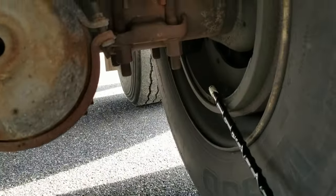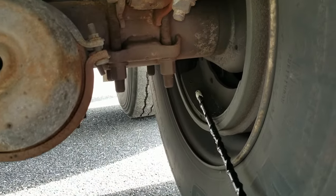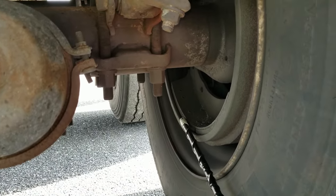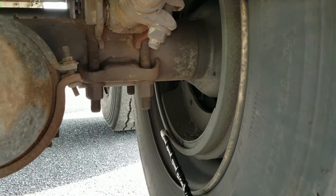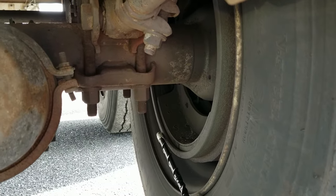I'll move into my brake shoes and brake drums. Make sure there's no signs of oil or grease, the brake drum is not worn dangerously thin, I have at least a quarter inch of brake pad, and the brake drum is not cracked, broken or warped.